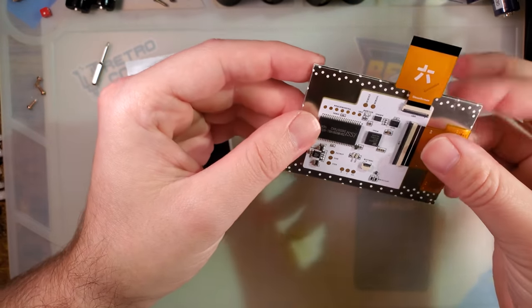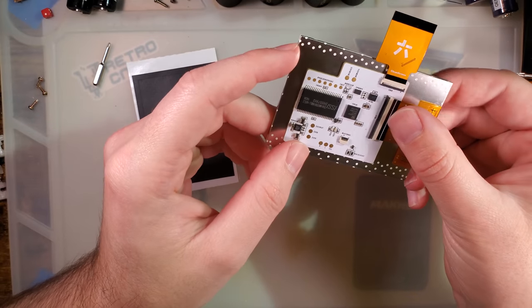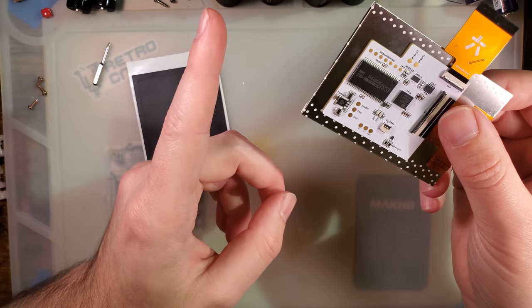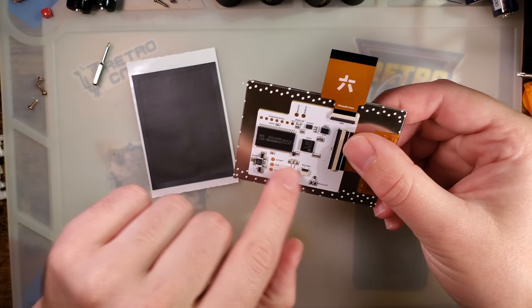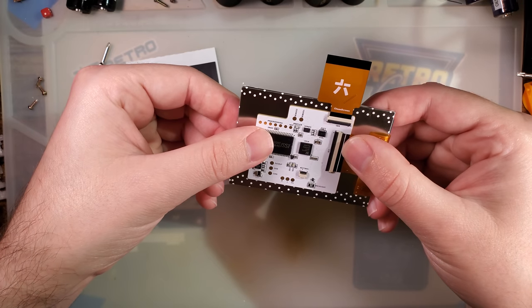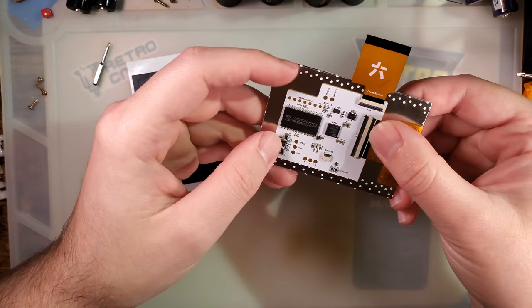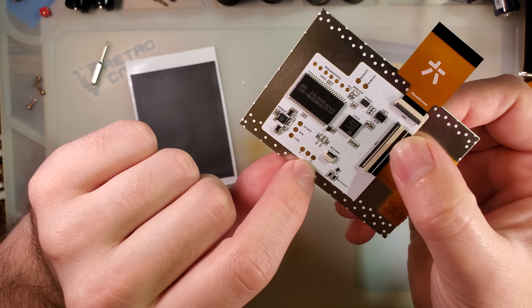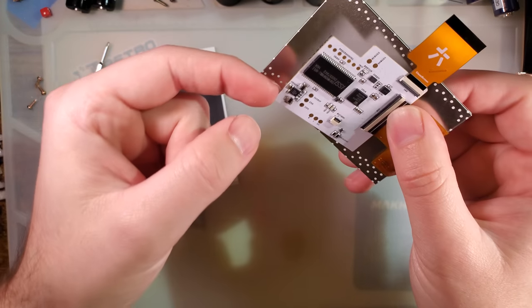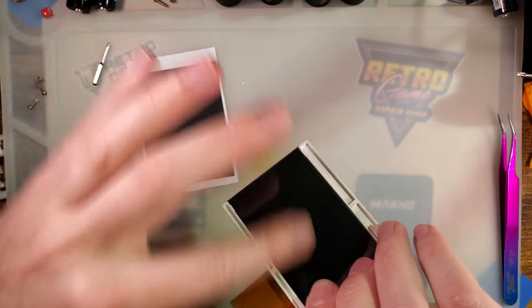You can add a little bit of tape if you want this thing to not move, but I highly recommend not doing that for two reasons. One: it's going to make the install awkward if you get that lined up and then try to get this ribbon in place because your PCB needs to shift. Don't tape this down until you have it lined up first. Two: if you need to solder to yours, the solder pins are right here — nice and easy to access.